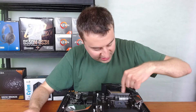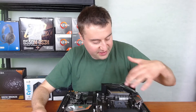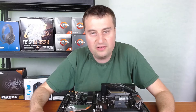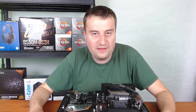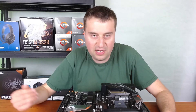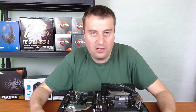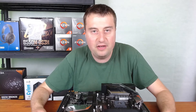There's plenty of cooling — it looks like a 6 by potentially 5 phase VRM, though I'll confirm that below. The VRM should be perfectly fine. For the 5000 series I'd say anything up to about a 5800X would be fine on this board. If you're going up to a 5900X or 5950X you can afford the extra for an even more premium board, but when released this was the top tier B450.